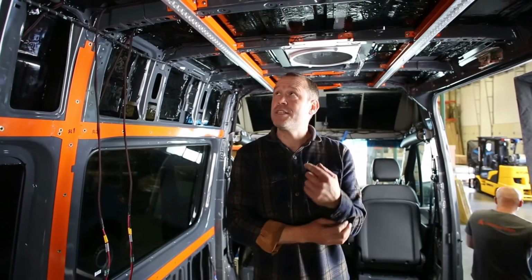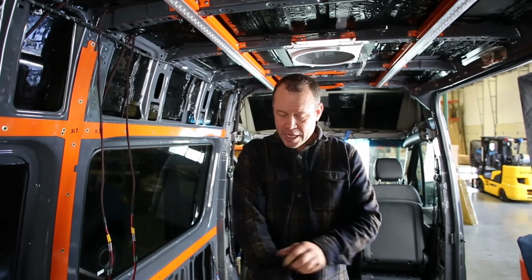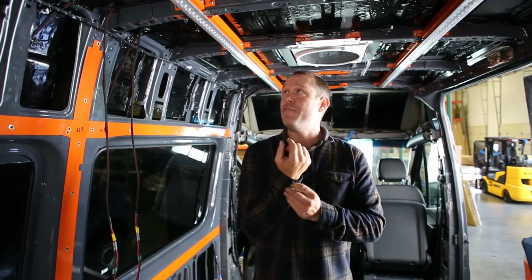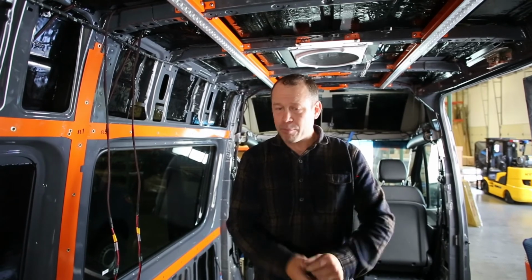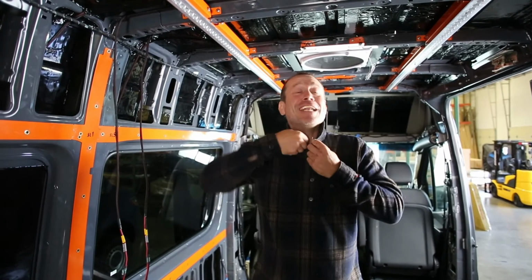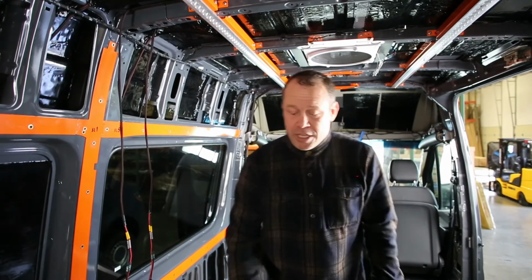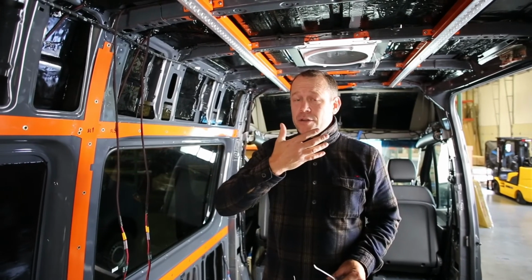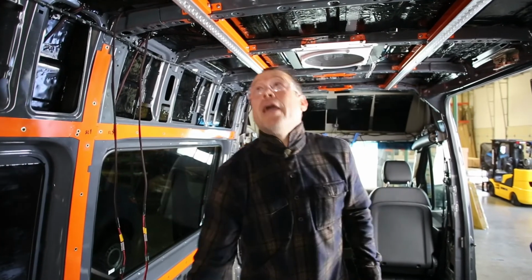We're going to put the step bit through these holes, and it will dump large pieces of very hot steel down on you. And it is no joke. I've had burns on my face that have lasted 2 weeks. And if you get it down your shirt or against your neck, it'll leave a mark. So definitely wear your eye protection, and if you even have a full face shield, this is the time to use it. Okay.